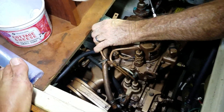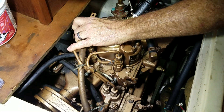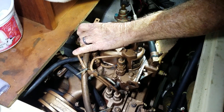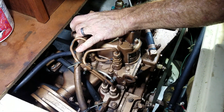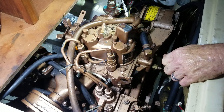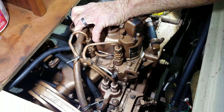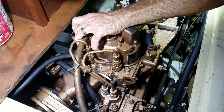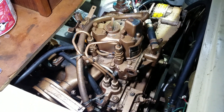Right here, this is a compression release. It allows the intake valves not to close fully. So if you have a low battery, you could start it by hand. But if your battery's low and you're getting a whomp, whomp — if you come here and somebody holds this open, there's no compression. The batteries usually have enough left in them to get it spinning, to get the inertia of the flywheel. Then you pop, boom, and it'll kick.